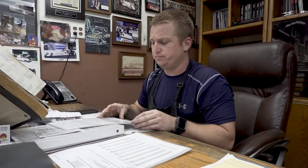We bolted them on. We used a 7.900 length 5/16 push rod, and that length push rod was used in all three of the different camshafts we tried that day. So if you guys are trying to develop a top end package, all those components will work. And one of the last things we needed to touch on is we used 40 weight Valvoline oil in this engine for these flat tappet cams, VR1. And VR1 oil, we feel and have felt for the last 60 years, is definitely compatible to be used with all flat tappet camshaft applications.